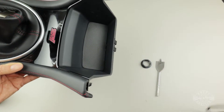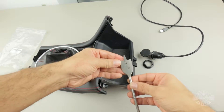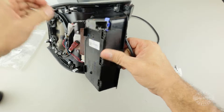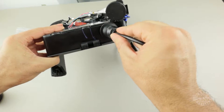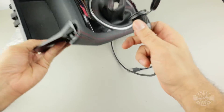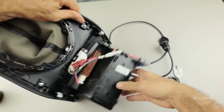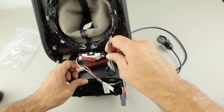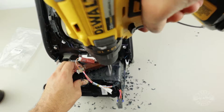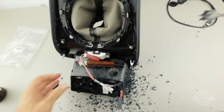Back at the bench, take a closer look to find the best spot for the USB port. This will require some drilling — if you get this cable you'll need a 1 and 1/16-inch drill bit for the hole. You might be tempted to put the port toward the back, but once installed there won't be any room back there. Make sure you check that the port will fit properly once the bezel is installed. I settled on this area here because there's plenty of room behind it. Mark the spot, then very carefully make the hole by pulsing the drill — go slow and retain good control so you don't damage anything underneath.